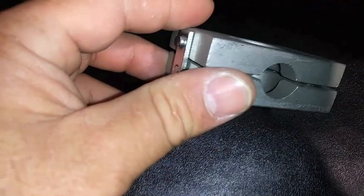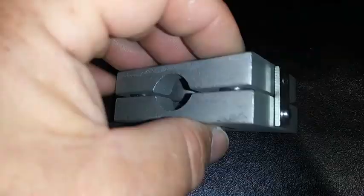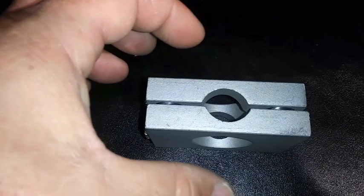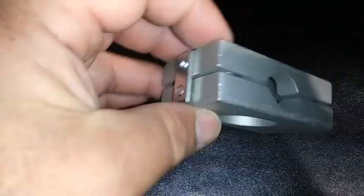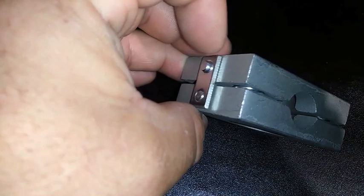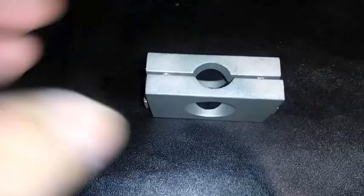Welcome back. Today I'm going to hook up this Phantom Grip style differential locker. This goes inside your transmission, inside of your differential for your Acura or Honda Civic. Once it's inside your differential, four springs on each side, it expands and serves like a limited slip. You take off these lock pins. It's kind of like an LSD but not quite. I'm going to hook it up inside my car.